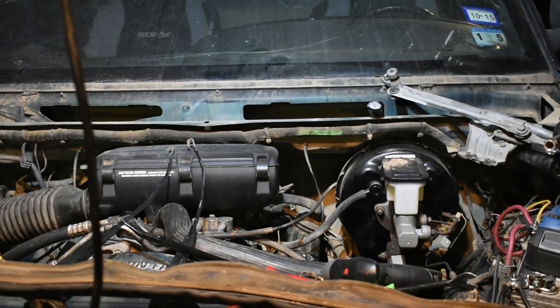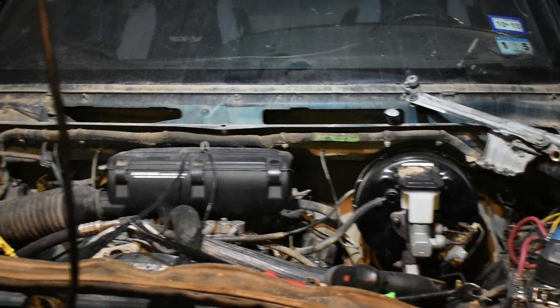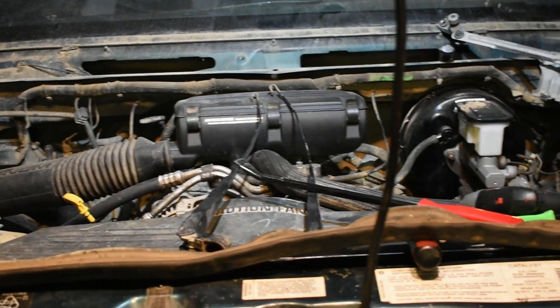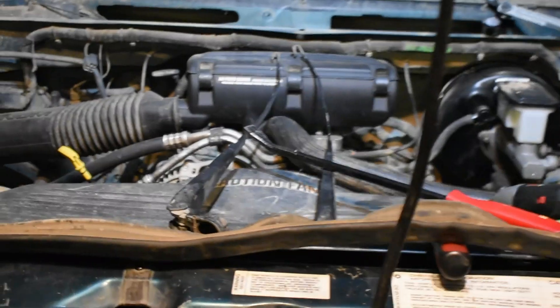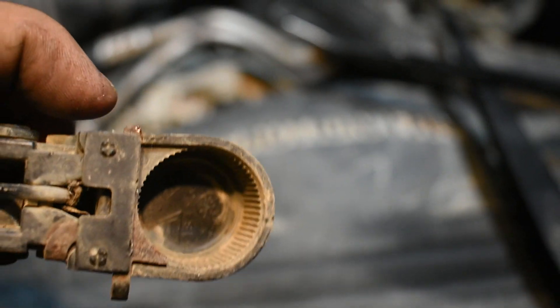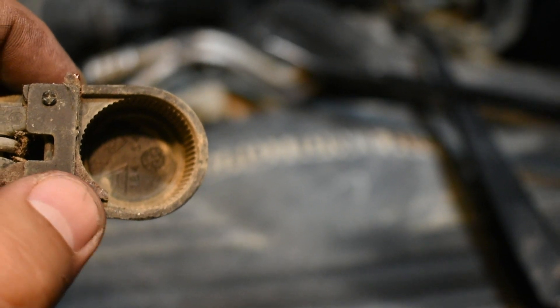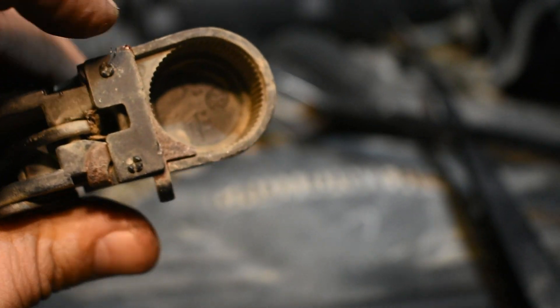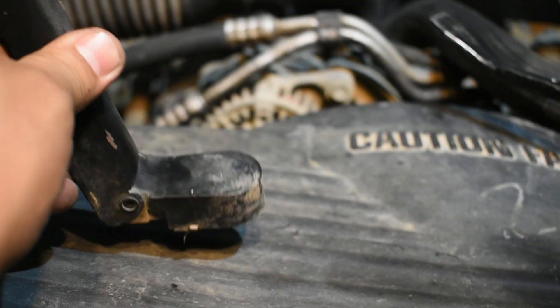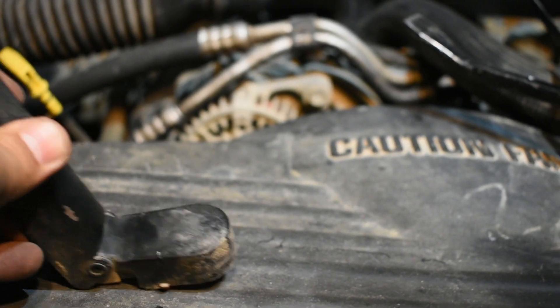To give you a better idea, what I have to do is remove the wiper arms. I couldn't take them off unless I remove the hood, so I have to remove the hood to get to the wipers. Basically there is a little lock on these things. When they are installed they sit like this — you have to push the pin so it can free the arm, and then wiggle it a little bit. You have to bend it into position and wiggle until it comes off.